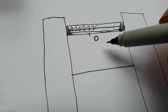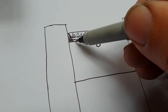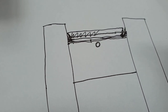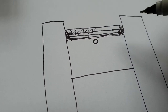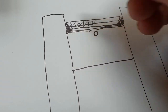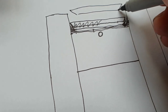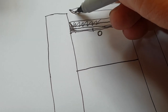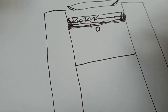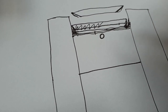So I took the pin down a bit more, only to then find, of course, that this was now undersized. We're talking a couple of thou, but it was undersized. And of course, then I wasn't happy. So you have to make sure that when you're putting in these journals, you've got the exact amount of chamfer on the side here, just to match what you've got. And don't make the mistake of thinking, oh, they're too tight, or they won't work, or it's not being ground enough and stuff like that.